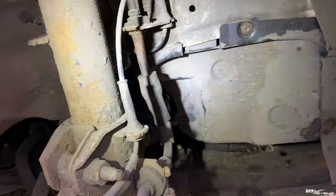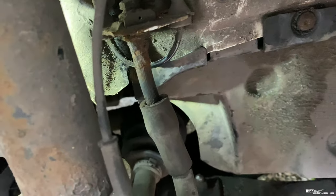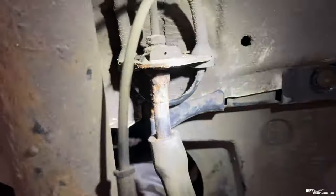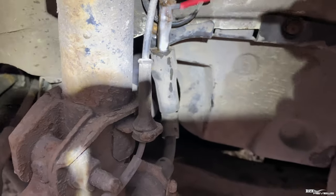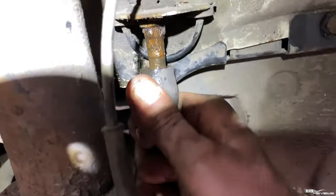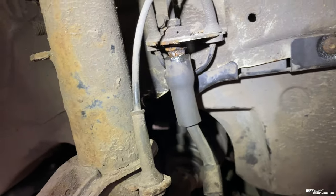When you're removing the access panel, there's a little screw just behind this pipe here. What I did was pull the sleeving down to provide access to it, and you can get in there with a little Torx bit to gain access to that screw — it's a little bit of a bugger, but it's alright. Once you pull the sleeving down on that brake pipe, I just sprayed some WD-40 down into there, which enabled the sleeving to ease down. Be careful that you don't put any undue pressure on that brake pipe because you don't want it to leak — it's your brakes, going to the caliper.